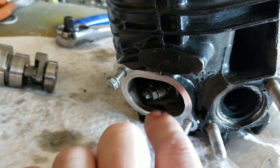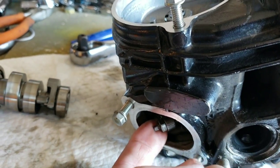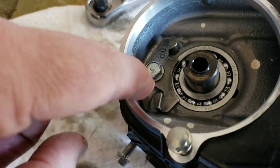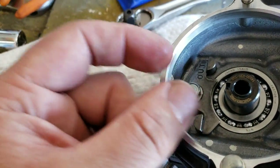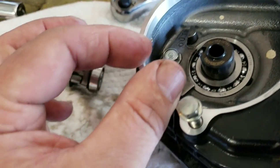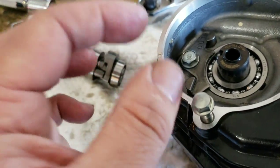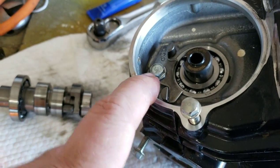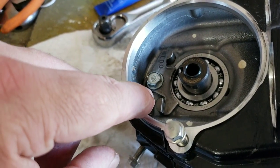So we'd put the exhaust one in, put the needle bearing in, keep your finger on the bottom of it, slide it in there, have someone looking down this hole where your shaft goes. Until you see that needle bearing lined up, set this in there nice and slow. It will slide in nice and easy. Okay, so if there's any resistance at all, don't push it. Move, wiggle stuff around until it fits. Okay, and then make sure your shaft is sitting in the right direction.